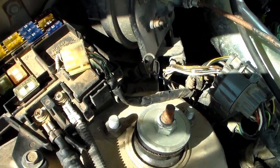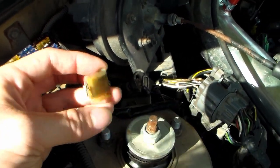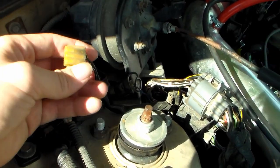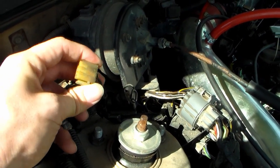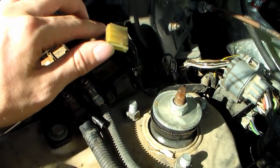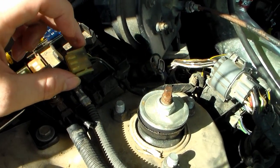Fortunately I had a spare non-VTEC ECU that I could throw in the car and I got it home. When you run a resistor in between these two wires, it basically tells the alternator to stay on, which just constantly charges the battery — which any normal car does. The ELD system was literally there to save some miles per gallon and cut down on emissions, but I've already upped my miles per gallon by putting a VTEC head on, along with some other things.